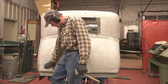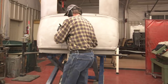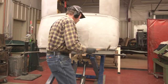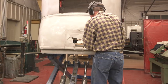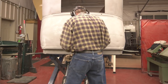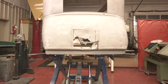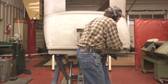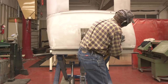Back in the 1930s when these cars were manufactured they were built with 19-gauge metal — mostly deep draw and extra deep draw, which makes it very formable. Unfortunately we can't buy that 19-gauge deep draw and extra deep draw anymore, but we can buy 19-gauge. It's available on the East Coast of the United States, so I always go back and buy a load at a time. The reason I make the special effort to use 19-gauge is it works easier than the 18-gauge you can buy at the local supplier, and also because it's the exact same thickness I can heliarch that and planish those welds out and they virtually disappear.